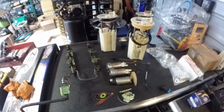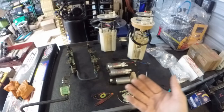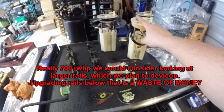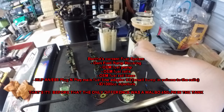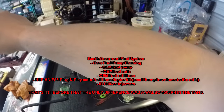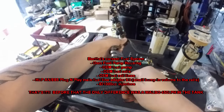When people say you need to upgrade your fuel system, they're full of it — you do not need upgraded rails unless you're going 800 to 1,000 wheel horsepower. To review: at the max, Bertha had 650 wheel horsepower with a J32 A3 turbo, stock fuel pump housing, Walbro 450, HLP E85 AN fuel line kit quick-connecting to the stock fuel rail lines, stock fuel rails, and ID1000 injectors — that's it. The AN line runs the full length of the car to the fuel rails and quick-connects in.